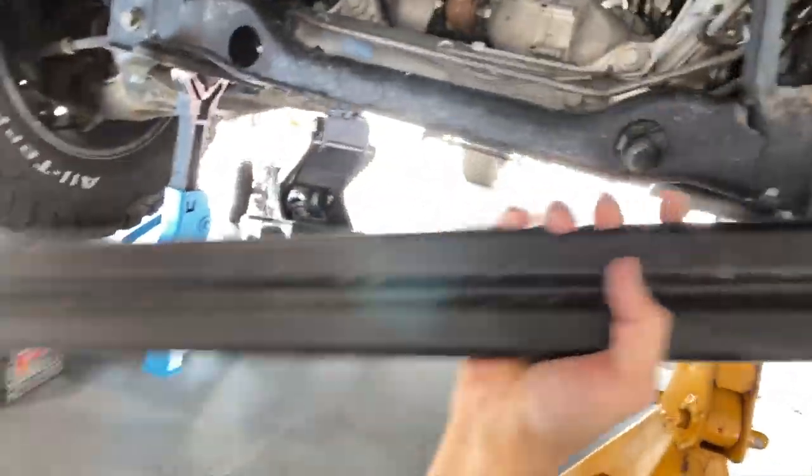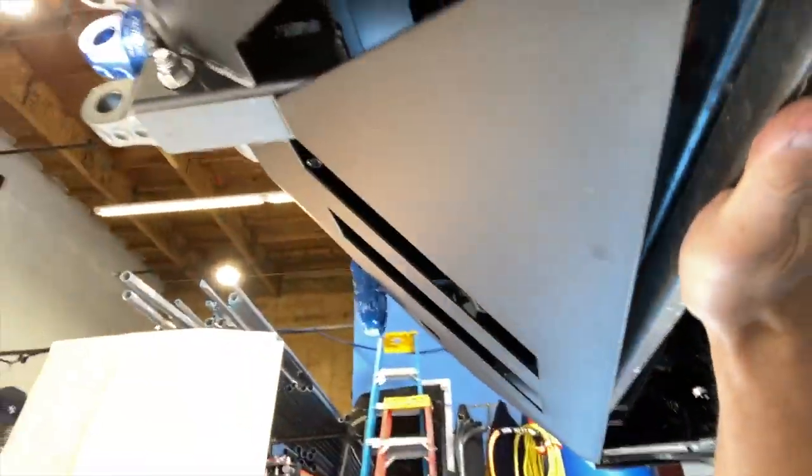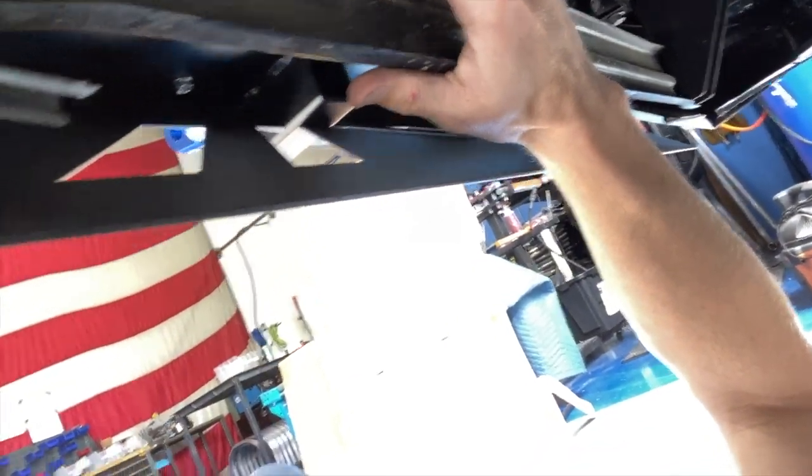The first thing we're going to do is remove this piece of sheet metal that I have in my hand. It goes right up here — there's this sheet metal running across the front of the engine, and there's just two bolts in the front of it. Maybe I can get my camera in here — there we go. Remove those two bolts and the same on the other side, and then this piece just lifts right out.